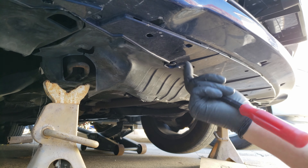Followed by the battery hold-down bracket. Using the same socket, we loosen this bolt, then loosen this nut, and once they're both loose we remove the bolt. Then just unhook this rod and remove the bracket entirely. And out comes the battery — making sure that you grab a good hold of it when removing it.